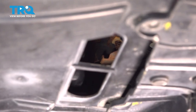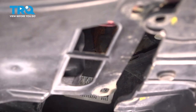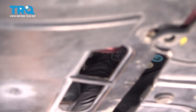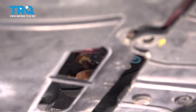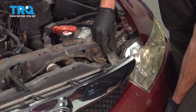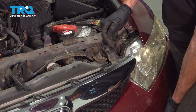Now we are underneath the bumper cover. If you have fog lamp assemblies, grab onto this area and pull it out of your way. Then reach up inside the bumper cover and disconnect the wiring harness. Ours has assemblies but I don't feel any wiring harness up here — I'll double check the other side. Once they're both disconnected, you can move along. Now let's make our way back out from underneath the vehicle and remove those two screws that we had started in by hand.